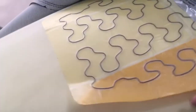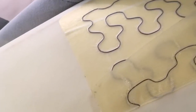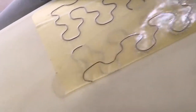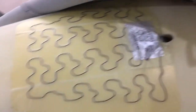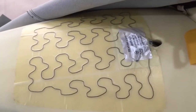Here I'm peeling back the sticky adhesive to secure the element in place, being careful to make sure there are no wrinkles in it so that it's on straight. Hopefully there won't be any problems down the road where the seat cover squishes it and breaks one of these wires, causing the element to be defective or malfunction.